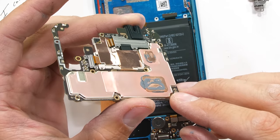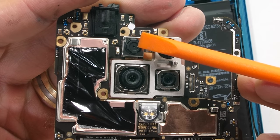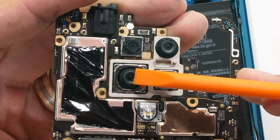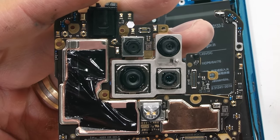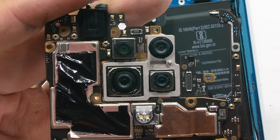There is quite a bit of copper on the back side of the motherboard — this is what comes in contact with that vapor chamber. The depth sensor, wide angle, and 64 megapixel main camera, along with the 5 megapixel telephoto camera, all do not have optical image stabilization. So that would be something to consider if planning on buying this phone — OIS is kind of important.